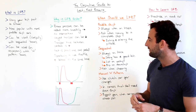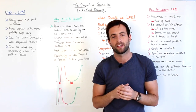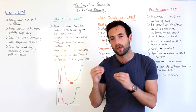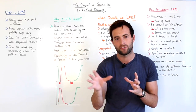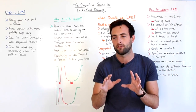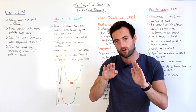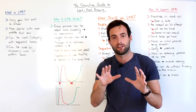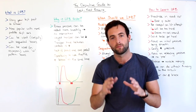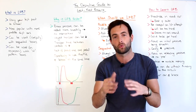The final reason is that we have the opportunity when left foot braking to use the brakes at the same time as the accelerator. This isn't something we want to do at every corner — there's really no need. Where this is useful is, for example, a fast corner that's almost flat out. Think Copse at Silverstone in a car that has some aero. It's actually quicker to keep the accelerator flat out and just brush some brake pressure into the car so the car will just turn in, transferring a little bit of weight to the front. The alternative is to lift off the accelerator, but this actually causes quite a lot of weight transfer and isn't as quick as just brushing the brakes.